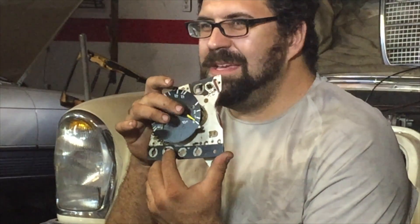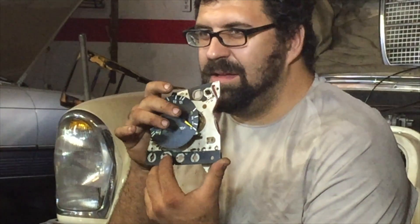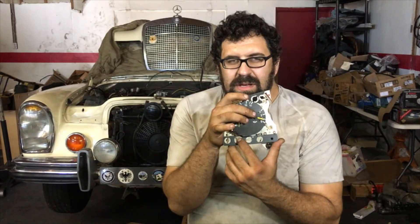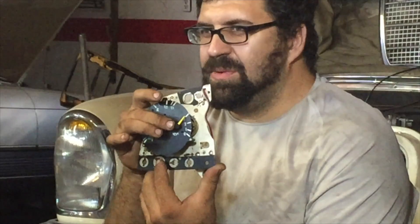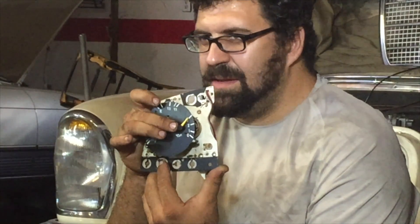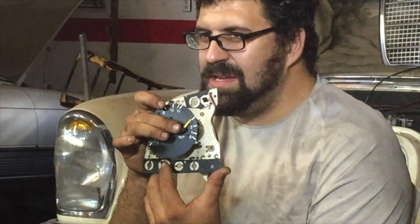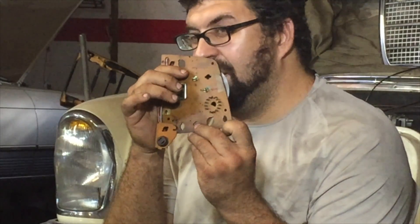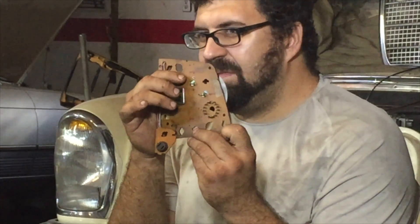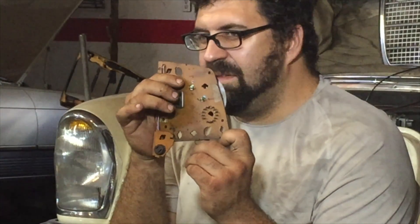With the engine off, oil pressure is going to be at zero bar. When you start the engine cold, you should get this — the oil pressure is going to peg and it's going to reach the 3. This is with any Mercedes; if it does not reach the 3, you have a problem. Especially if you have a mechanical oil pressure gauge, like you would on all 123s, all 115s, all 116s, and all first-generation 107s.